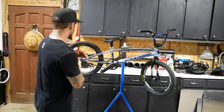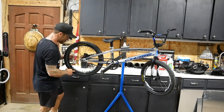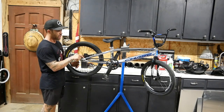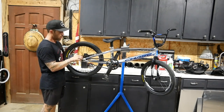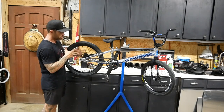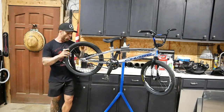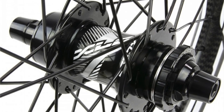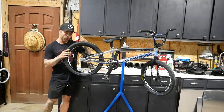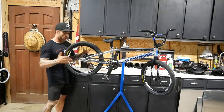You don't actually have to have a specific frame to have disc brakes set up on your bike. Rear wheel - same XSX X-Lite Comp wheel. This hub is super cool as well. I have a 13 on here - you can go down to a super small cog on this hub and all the way up to an 18 or 19, whatever you want to run in the back. On the disc brake side, maybe you want to buy a wheelset but you don't have disc brakes. This hub set has a little screw-on adapter over the hub that looks like a normal hub without a disc brake if you were to have V brakes. But if you want to convert to a disc brake setup, you just unscrew the cover over the hub, back it off, it exposes the threads, and it comes with an adapter kit - you screw on a disc brake mount, bolt your disc brake, boom, you have a disc brake rear hub.